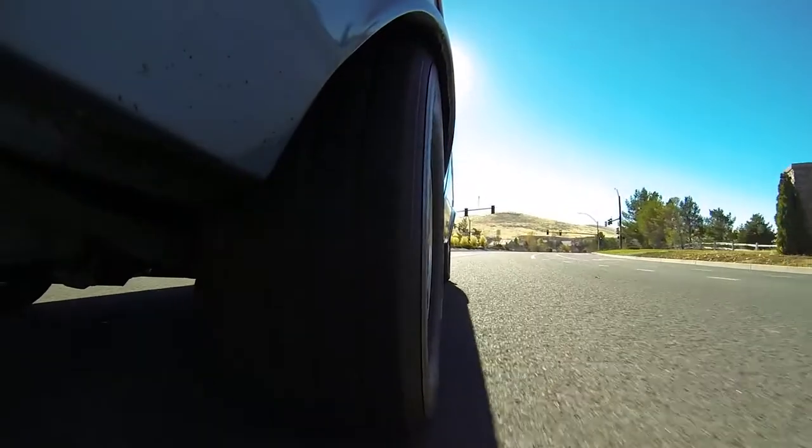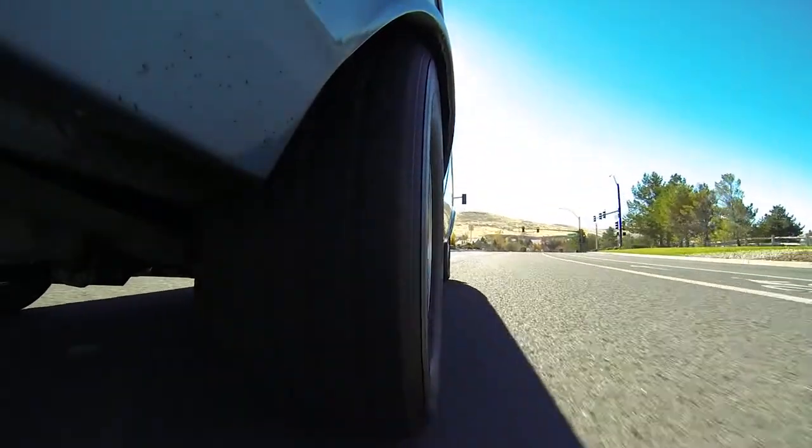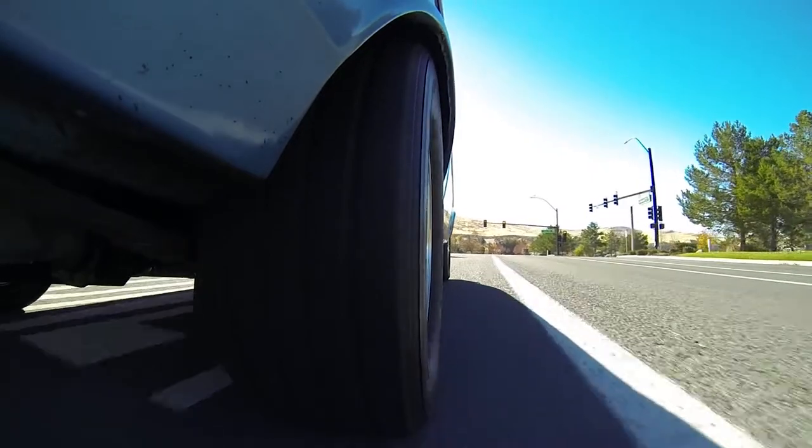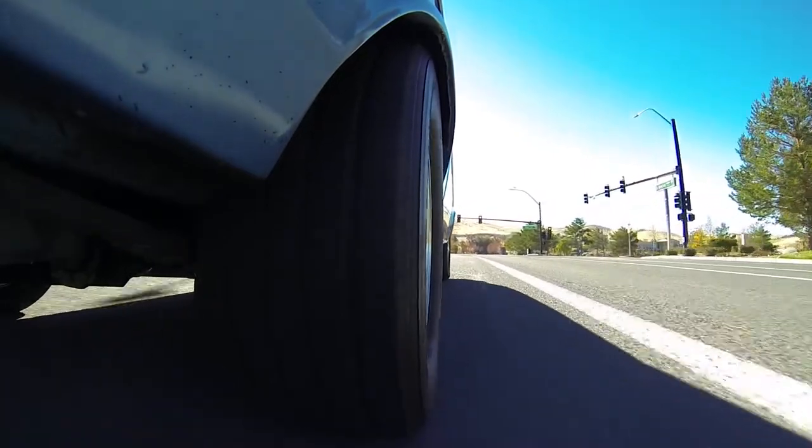I built it to also put either a bottle or a small blower on it, so I kept the compression relatively low. It responds really, really well to nitrous. It's had a 100 shot on it. It runs really good. It's got a 3.08, 8.5-inch 10-bolt in the rear. Try to keep it relatively streetable. The 3.08s make it pretty livable on the street. We're cruising it around, you can drive it anywhere.